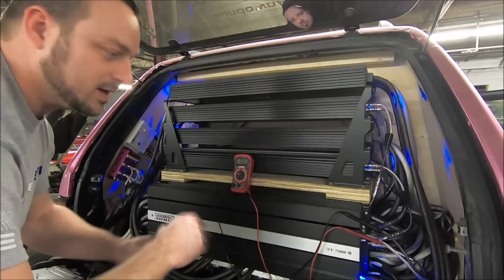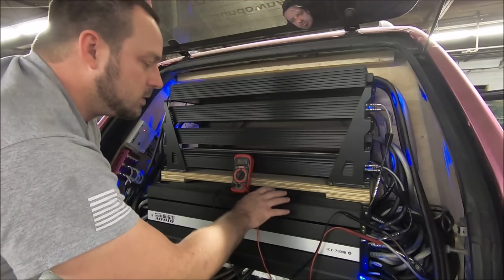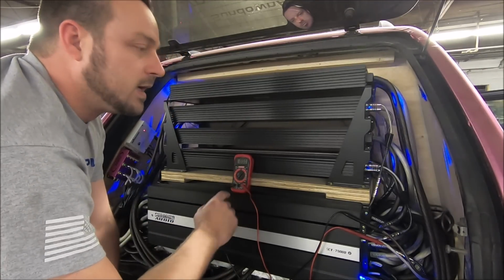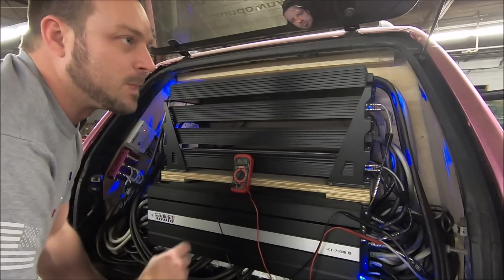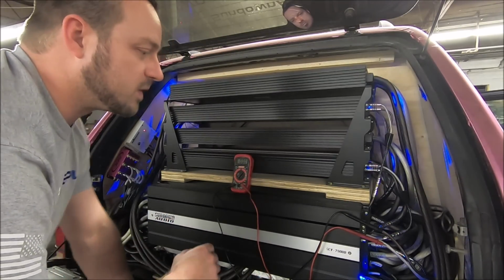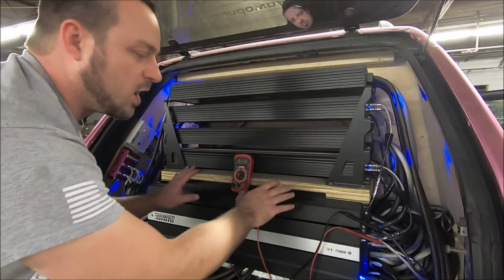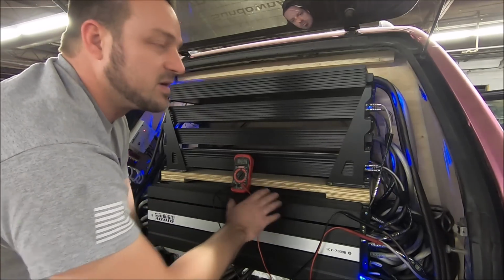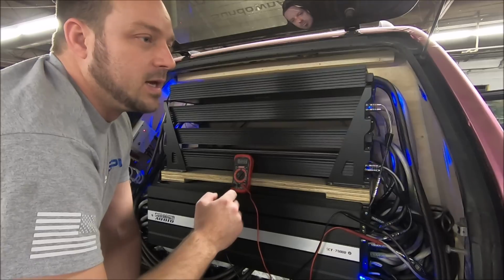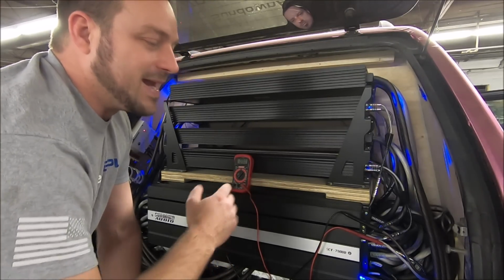Now, I'm going to do this at low volume to simulate it, but say I do a burp and I don't quite get full potential out of my amplifiers. So say I'm at volume 40, and that's my max volume I want to be at, and I don't quite get full potential. Say I'm off just a little bit. But if I try going up in volume on my head unit, either my head unit starts to clip where I might need more output voltage on the pre-out side, or say if I want 100 volts of good clean output voltage from my 7500s, at volume 40 I'm at 95 volts, but at volume 41 it jumps to say 110 or 115. Say I get a pretty good jump at that one click in volume, and now I'm clipping and it's hurting me.